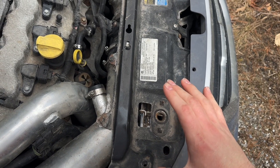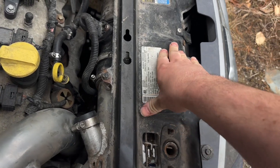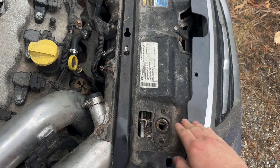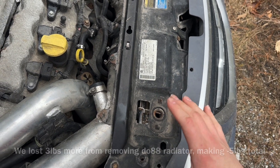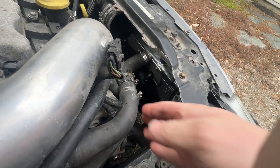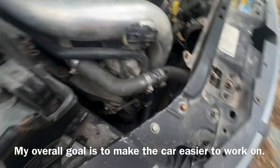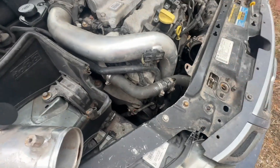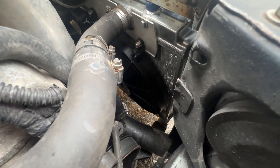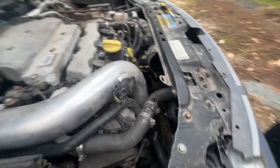The entire install is done. The car is cooling incredibly well and the new fans are much quieter than the stock fans. All things considered with the brackets we added, we've lost about two pounds from the stock setup — which doesn't sound like much, but we installed a larger radiator and still lost weight. With the pipe removed you can really see how much further forward this radiator is sitting — there's so much room I could probably pull the power steering pump from the top if needed. The bracket is all prettied up and not too sharp.